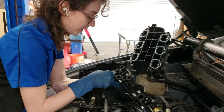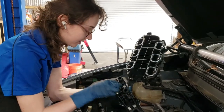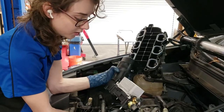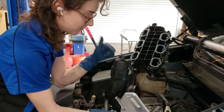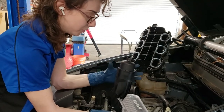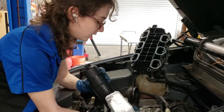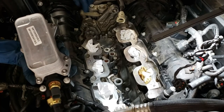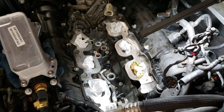These parts generally come with all the gaskets already installed. Visually verify that every gasket is in, and there's an O-ring here. The sensors are already installed. I read that there was a filter already in the oil filter housing but I'll need to open it up when I install it and make sure. All of these mating surfaces need to be as clean as possible — I took a plastic razor blade and scraped all of the mating surfaces.